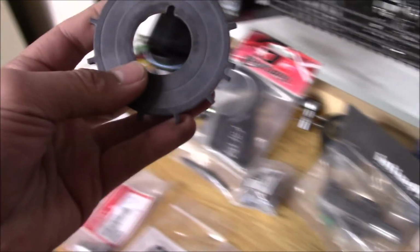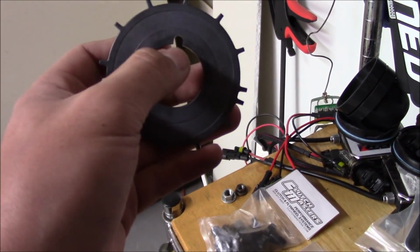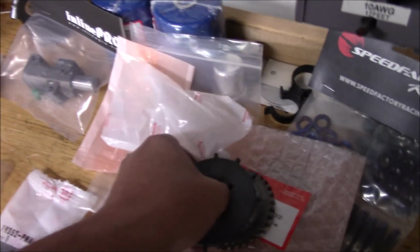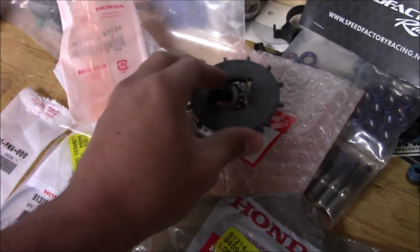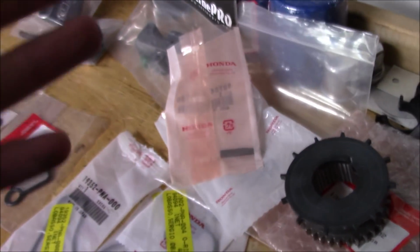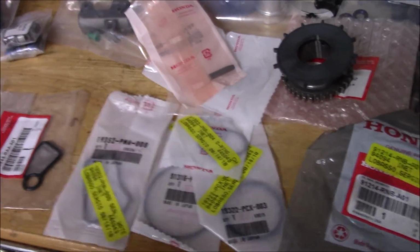They give you a new one of these. Some of them come with a little tit that hangs out. Well, they open it up here so the same Woodruff key can go into there. So basically these two we're gonna line up just like that, right? And then they give you a longer keyway. This is gonna ride inside of here, both of these right here, and that'll line up in the crank. Again, I'll give you a way better explanation of how this works when I'm actually assembling the motor.